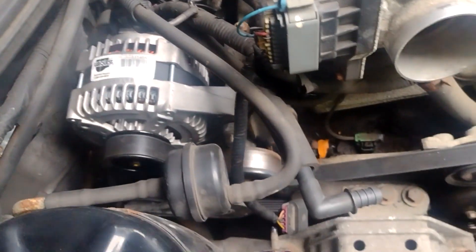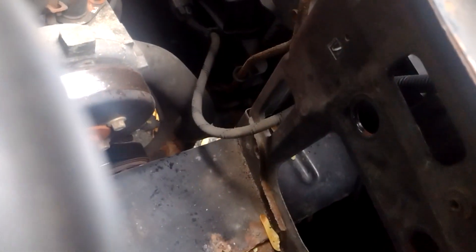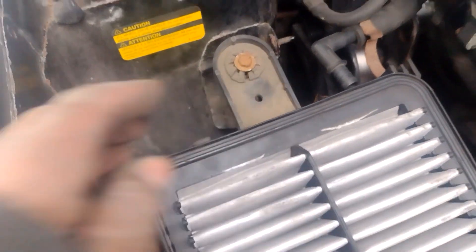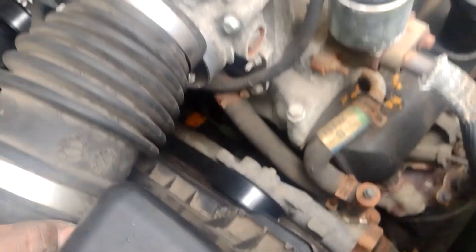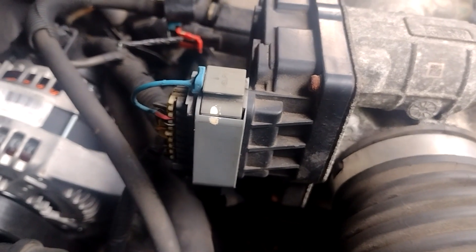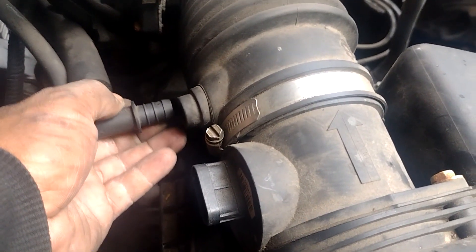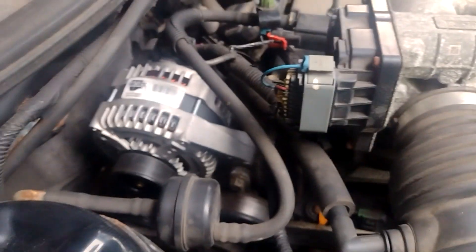We got the belt back on. We can go ahead and lay the air box back in. Feed this in with the little prongs, down into the little holes, with the circle piece going up open. Bolt it down with the 10mm up here. Put the top half back on, line these up in the little slots, then put the intake part back on — you'll see a little cutout right where that goes. Tighten that back down using the 8mm. Plug the evap in on the PCV, and the mass airflow. Don't forget your little clip — got the little white clip in down there.